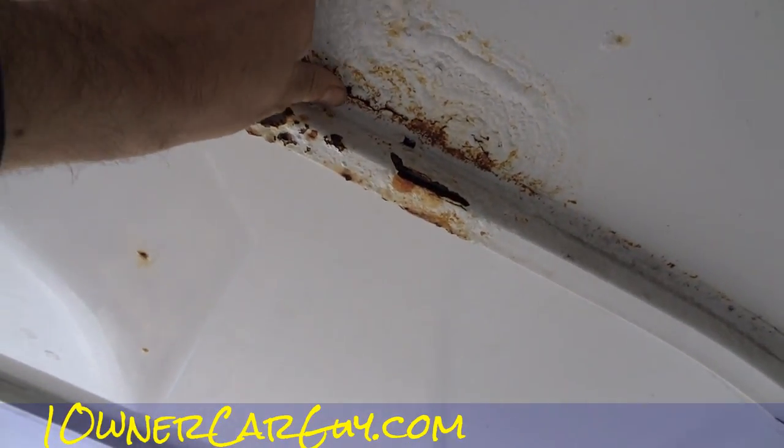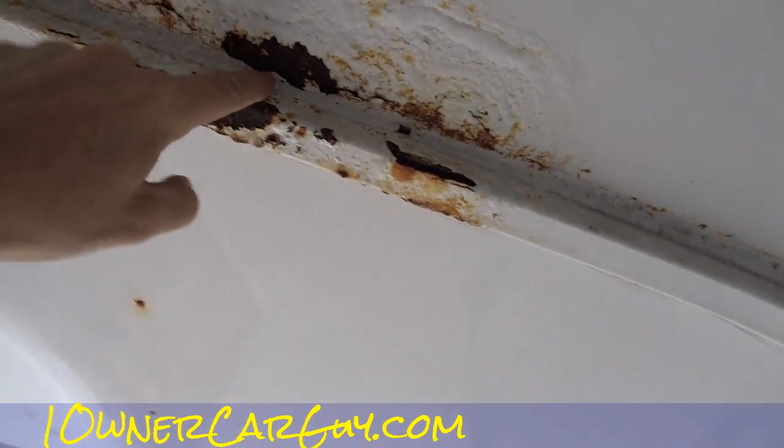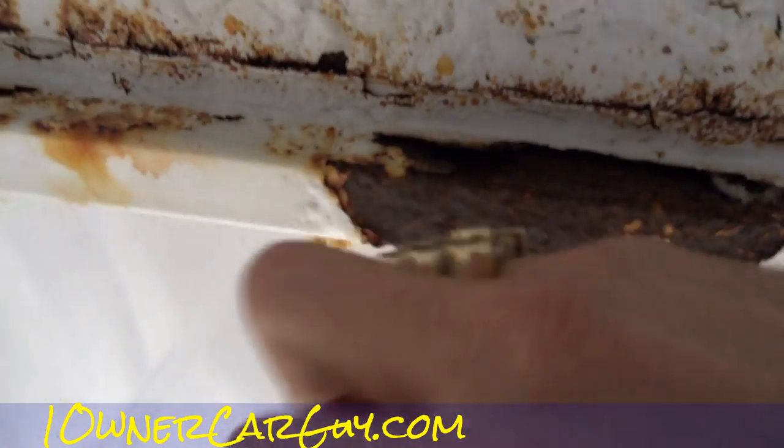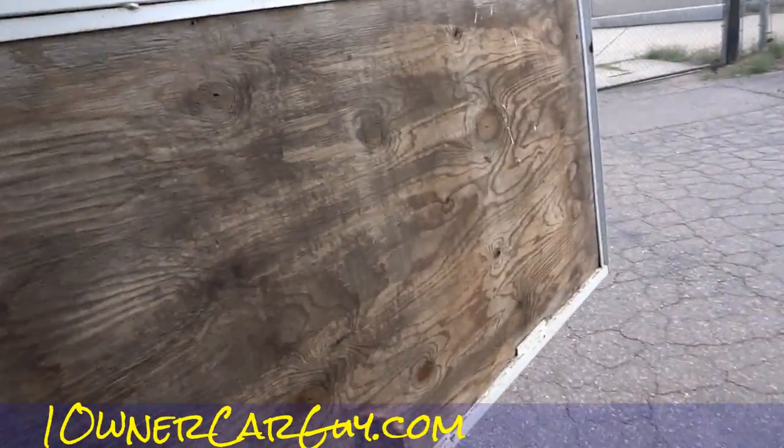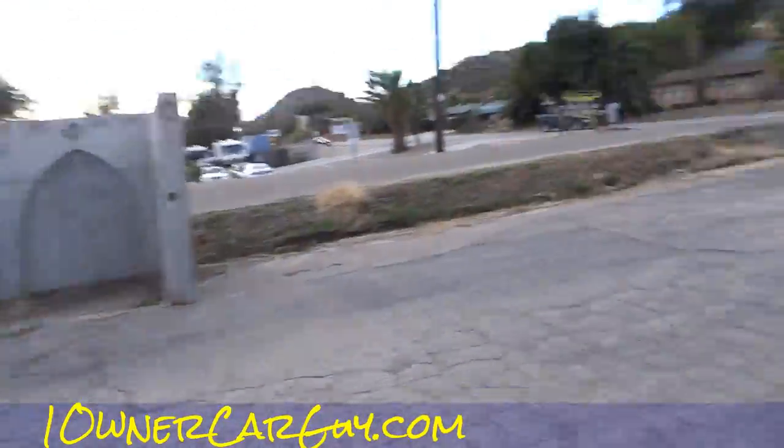The lights all run with your trailer lights. From the inside you can see it's starting to leak through a little bit — you'd need to break it all off and skim-coat some fiberglass. It's mainly paint that's coming off right along that seam, and then it gets under the paint. Underneath it's nice strong metal — same thing here, just that top layer of paint. Nice and solid. That's your inside.